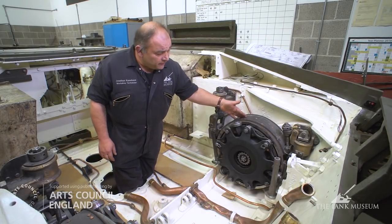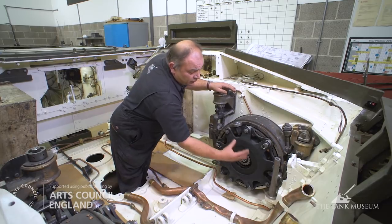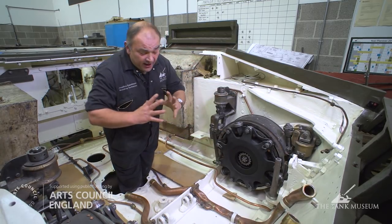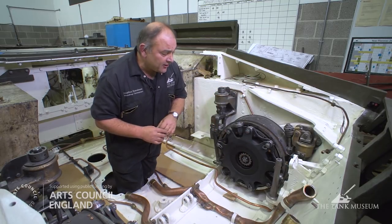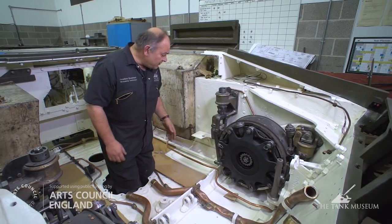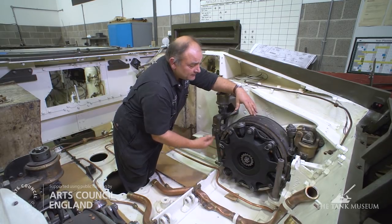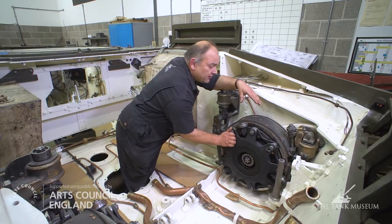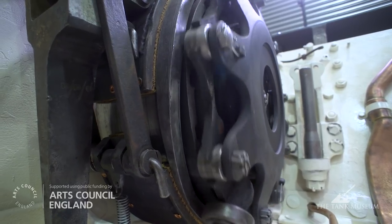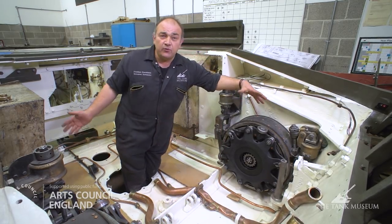Just to go through the operation of the steering clutch. On the outside, we have this brake drum which goes around the outer drum. On the inside, you've got another drum and a plate with loads of powerful springs underneath it. These compress the plates inside, and the action of them being compressed actually forces the drive out to the tracks and allows the tank to move forward. When the driver wants to make a turn, he'll pull in on his right steering lever. This operates the control rod through the steering actuator and compresses the brake pad onto the outer disc. That stops or slows down that outer disc and the inner one then starts to rotate. These rollers then roll up the cams, which separates the plates on the inside and disconnects the drive from that side of the tank. Because the drive is already operating on the other side, that enables the vehicle to steer.